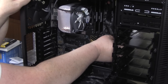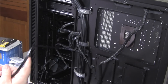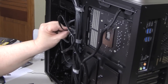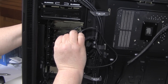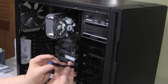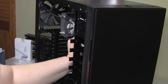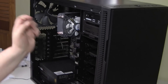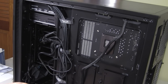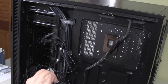Now I'm just connecting up the SATA cables. The DVD is SATA 1 and the 500GB SSD is SATA 2. Again, you can't use SATA 0 because the M.2 drive uses that — that was a real simple connection. The board comes with four SATA ports. The USB 3 connector is a really thick cable and the connector itself has real small pins, so I was kind of worried about bending them. I made sure it was lined up properly, but I think Fractal could probably design that cable a little bit better.